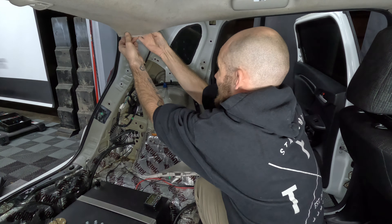With the pillar now removed, we can also see that the driver side C-pillar only has five push-in tabs while the passenger side has six — two on one side, three on the other, but not one on the bottom. The tab positions are exactly in the same place, but the driver side does not have one at the bottom.